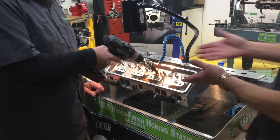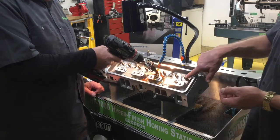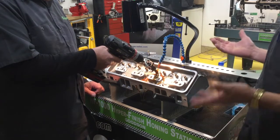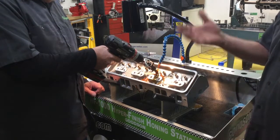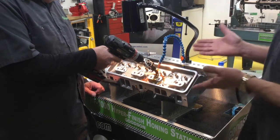We're setting up here now, getting ready to hone this valve guide. As I said, this Black Diamond hyperfinish valve guide sizing system will do bronze guides, cast iron guides, and steel guides — it really doesn't care what kind of material it's honing through, which is a good thing, because you guys are subjected to a lot of different alloys. Even in bronze — manganese bronze, phosphorus bronze, all the different bronze alloys out there — we've got it covered with this diamond material.